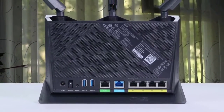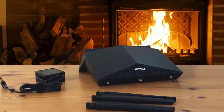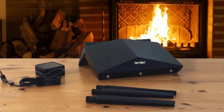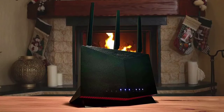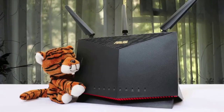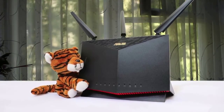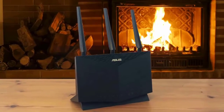This means that it looks very cool in the store or even using web photography, but if you live in a smaller space, be sure you know where you are going to put it because an upright pose is all you get. Most of the features of the ASUS RT-AX86U are identical to the RT-AX82U, so expect the same OFDMA support which is mandatory for any WiFi 6 router since it splits the channel bandwidth into smaller orthogonal resource units, allowing the transmission of smaller packets more efficiently at a lower latency. The ASUS RT-AX86U is a great WiFi 6 router that delivers speedy close-range data rates along with fast connectivity options, gamer-friendly settings, malware protection, and strong parental controls.